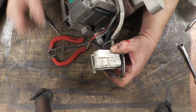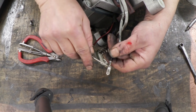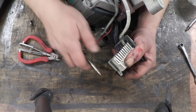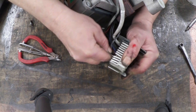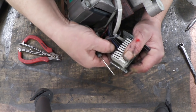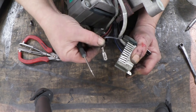To get these wires out, this connector usually folds open and in there is a little spring clip. You can see it just there and if you press that spring clip down that wire will just slide out. So you dig a screwdriver in there, get that spring clip pressed and you should be able to get that out. There it is — and just remove them all.